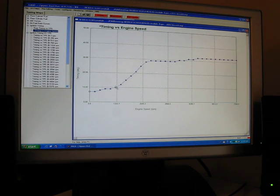We're going to start by adding timing in this general area here. This is your idle, which is going to be anywhere you set it from, say, 900 to 1000, which is somewhere in this neighborhood here. And then we're going to adjust timing the whole way up to 2000. 2000 is typical cruise beginning for your Harley-Davidson motorcycle. Anything below that is going to be your decel until it reaches idle. That's typically where you're going to be prone to have popping.